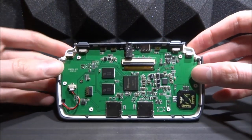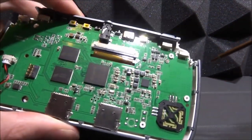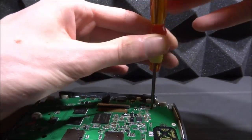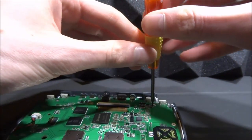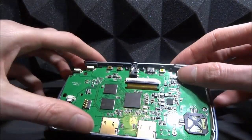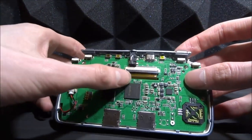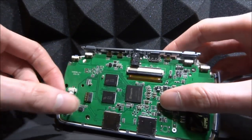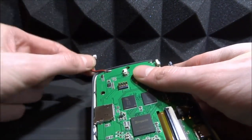There are a couple of screws we need to take out — one right here and another one just at the top. Make sure you don't miss that one. Once you unscrew those, the motherboard should pop off quite easily as there isn't really much holding it in. Put those screws to the side. Now we should be able to lift the whole motherboard off. Some people like to take the ribbon cable out for the screen, but it's not really necessary when doing the buttons. I'll take the volume connection out just here.